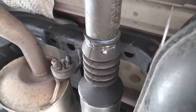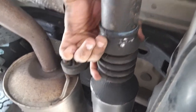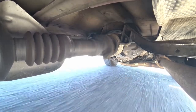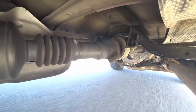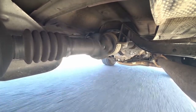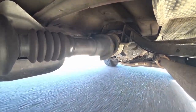All I've got to do is go for a test drive and make sure there are no vibrations — the boot is back in place. Before you remove the drive shaft, I recommend you first grease all of the zerk fittings and all of your U-joints. If you have a four-wheel drive, make sure you grease the front ones also.